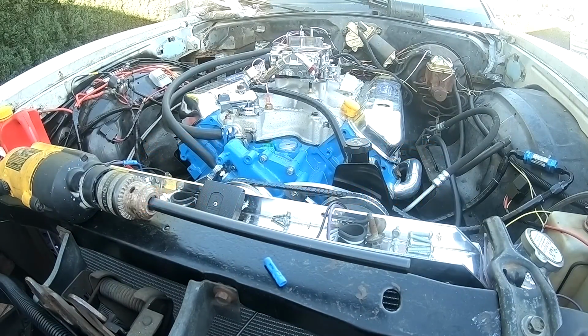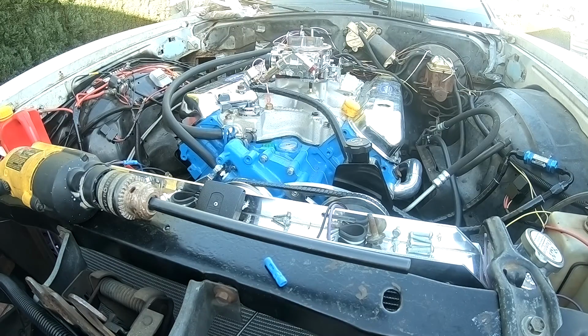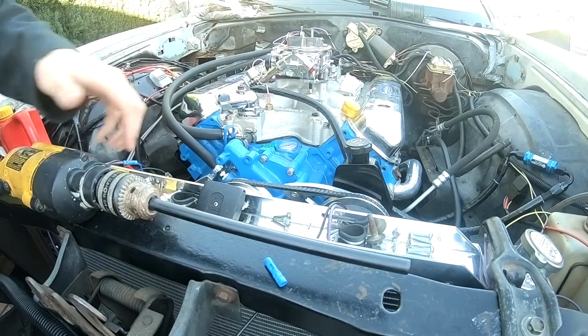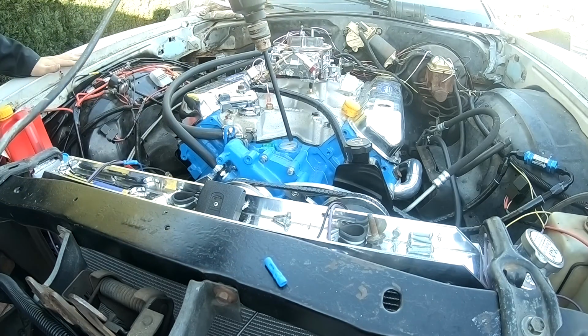All right, we got 4.5 quarts of oil in the pan. We got 1/2 quart into the oil filter. So now, prime. I'm gonna attempt to prime the oil pump. We got the specialized tool right here. Clockwise, just bring it in there and see what happens.